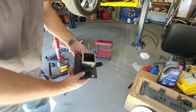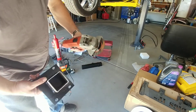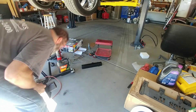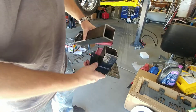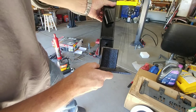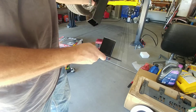I forgot to hit record when I cut it off, but anyway, I got a 4.5-inch cutoff wheel, went around it, marked it 3.5 inches, and just cut it off and cleaned up the edges. So now I'm going to go and basically replicate these holes in this bottom plate so that it'll bolt right in without all this extension. Hopefully that'll get us where we need to be.